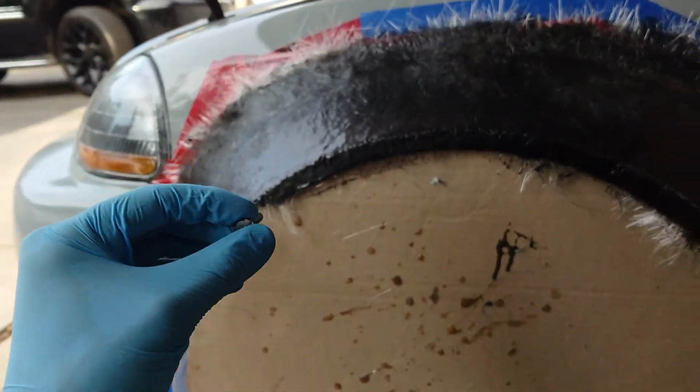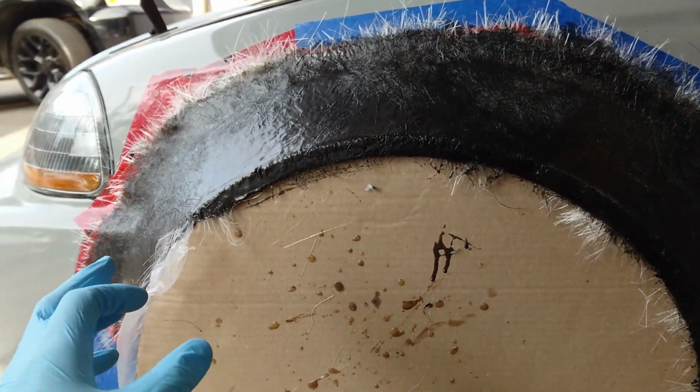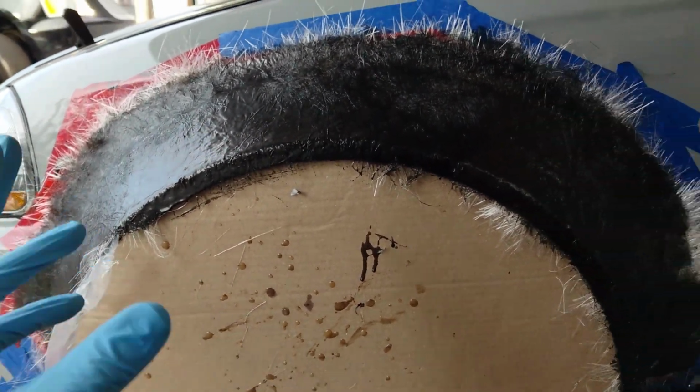So my plan is to slide them in with some bigger holes. We'll use just a 1/4 inch drill bit to open up those holes a little bit. And then we'll lay some fiberglass over the top and put some nuts on the backside and wait for that to cure. That'll give us that hidden hardware effect for a nice clean look.